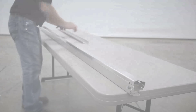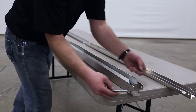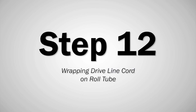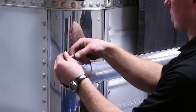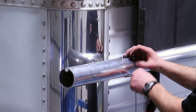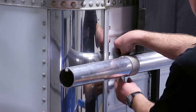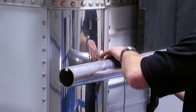Step 11. Lift the covers off both spring boxes. Remove the nut and bolt that holds the spring to the box and set all three aside for later. Finish emptying the spring box of its contents. Step 12. Tie a loose square knot in one end of the drive cord. Insert the loose knot into the groove on the roll tube. Slide the knot over and pull tight. Then wrap the driveline cord around the tube, always towards the box wall from the outside going inward towards the tarp. Wrap the driveline cord twelve full wraps and let the excess hang down. Slide the cord to be at least one inch away from the tarp.